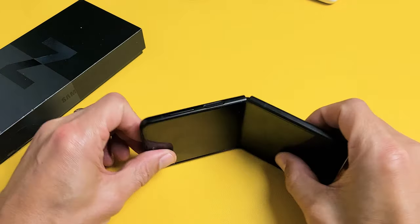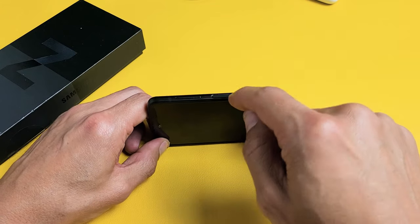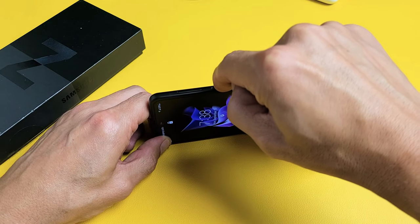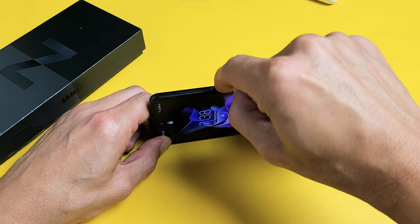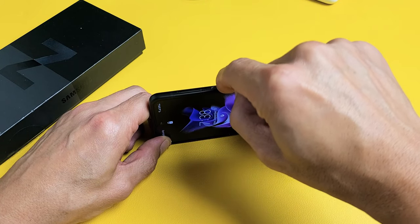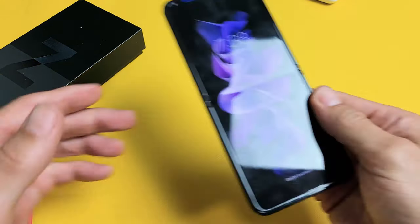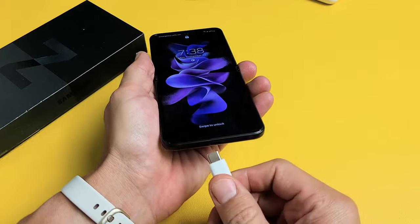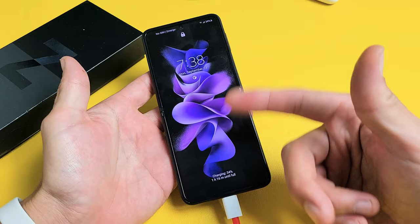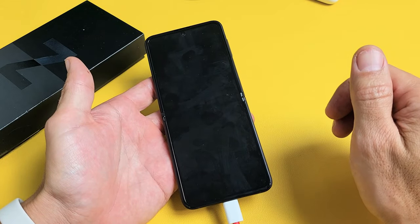So the next thing we're going to do is first, go ahead and grab the phone — you have the power button here. What I want to do is spam the power button. We're going to press the power button in and out a bunch of times, just spam it. Sometimes if you get coffee, apple juice, lint, dust, hand lotion, or sweat stuck in there, it can cause an issue with the power button that causes the black screen as well. So just keep doing that. Now go ahead and plug it in — plug in your charging cable. You should hear that noise. Wait about 10 seconds and give it a little charge.